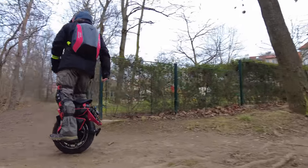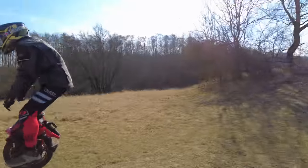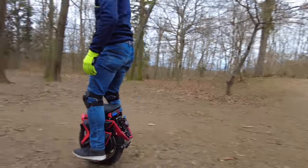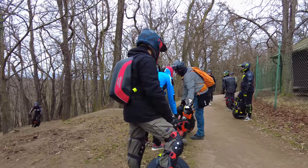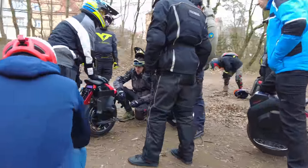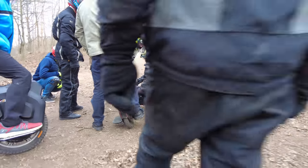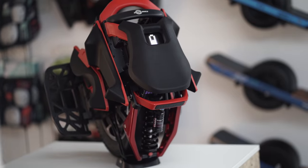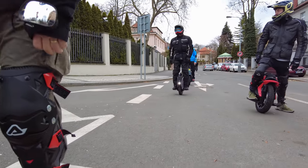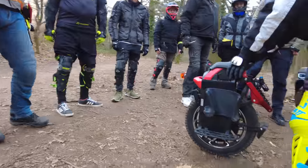You also get two power pads and two jump pads, which not only give the wheel a unique look but also help you place your feet in the most ergonomic way. However, there are a few problems here. Power pads are attached with 3M adhesive tape — in every video we say this is absolutely not a working solution, since even a simple change of riding shoes means you need to reposition the pads. Therefore, we immediately change it to Velcro. During testing, we have already repositioned the power pads 100 times for various needs, and it is impossible to imagine placing them once and never changing their position again. The plastic red plate also gives additional thickness, which leads to a decrease in handling and, for people with short stature or a narrow stance, causes discomfort when riding. This is a rather subjective factor — for some, these power pads cause no problems, while others want to take them off right away.